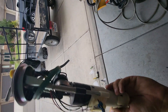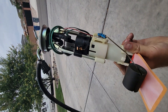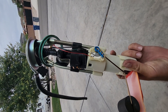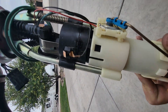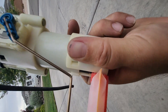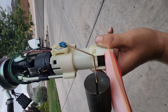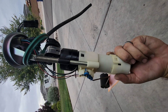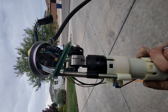I got the pump out and replaced. You can buy this whole assembly on eBay and it comes fully assembled. I chose to go the route of buying just the pump — you pop these three black tabs off, it slides down, then you pop the tabs on this one as well and unplug some of the harness to remove the pump. It wasn't too bad, but if I were to do it again I'd probably just buy the whole assembly. If you're on a budget though, you can rebuild it and go from there.